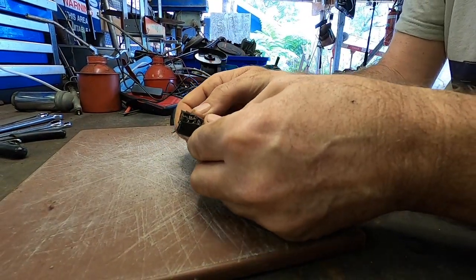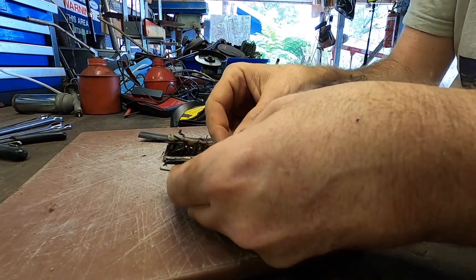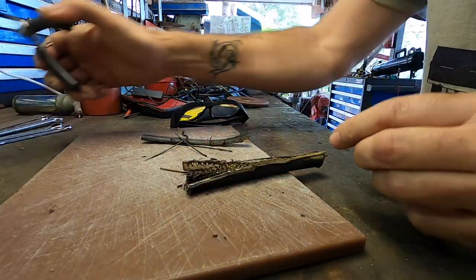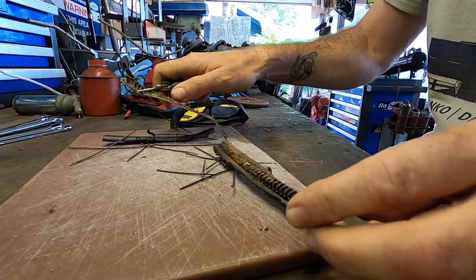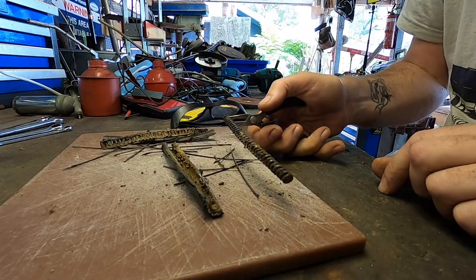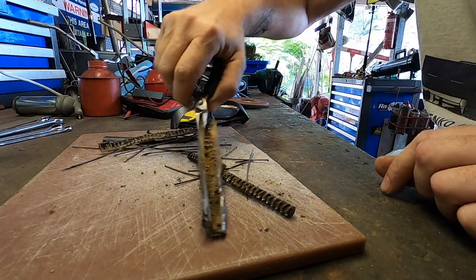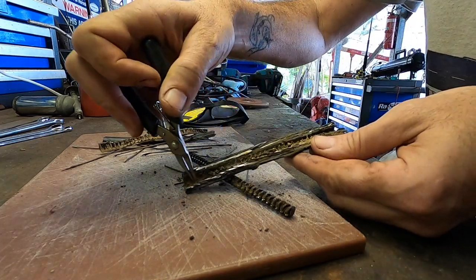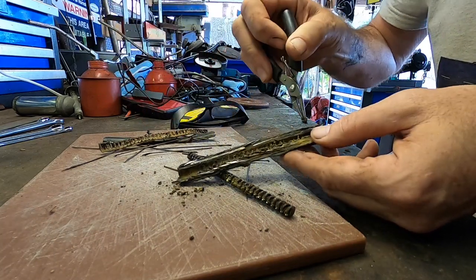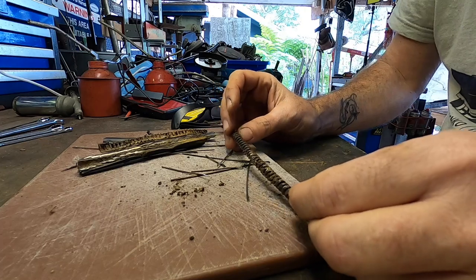The question that's always been on my mind is how far the spirals go. Here's the reinforcing — it's what makes the cable so hard to bend. Then there's a nylon sort of sleeve inside. Looks like the spiral goes the whole way — that was the thing I was never sure of. Was the spiral only at the end for the helm? You can see all this dry crud — that's supposed to be the lubrication, the grease for the cable. You can force oil down with compressed air, but I think you're fighting a losing battle by the time it's been sunk and then sitting in air for a couple of years.